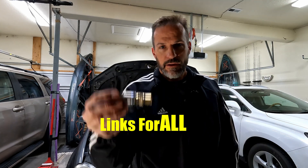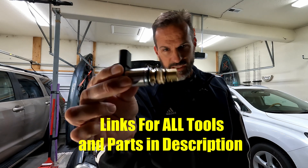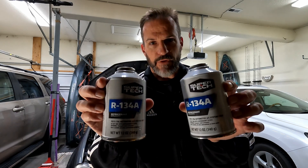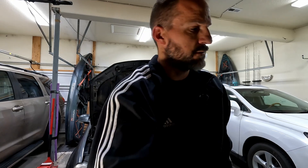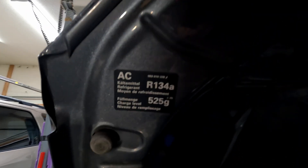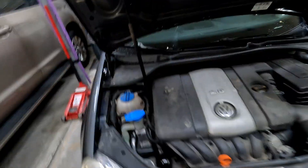In my case, I'm going to put a new valve on my air conditioning compressor because I have a German car and these tend to fail frequently. I'm going to need a couple cans — I couldn't find a large enough can at the store, so I need a couple cans of 134A. This car takes 18.5 ounces. Depending on your vehicle, right here it'll tell you exactly the type of refrigerant and how much you need. It might also be located down here on the car.